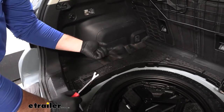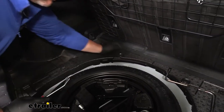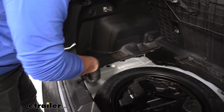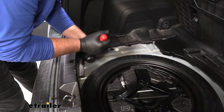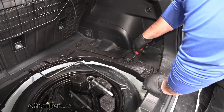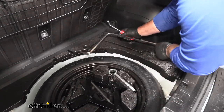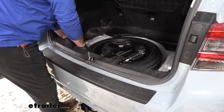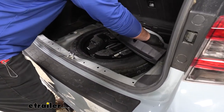Make sure you cover them because they are plastic and they will pop out pretty quick. We'll take this out and set it aside. We're going to come to this panel here — we're going to have a pushpin fastener here and one on that side, and we need to remove both of those. We'll come over to our passenger side and pop this foam piece off as well. Then we're going to take our threshold and pull up on it, working our way across until we get it loose, and set it aside.